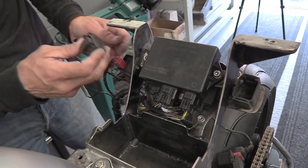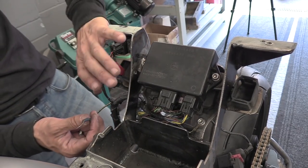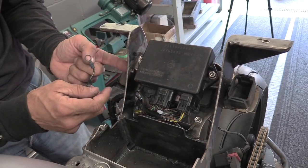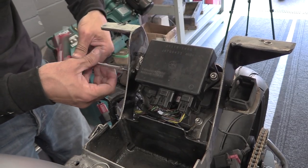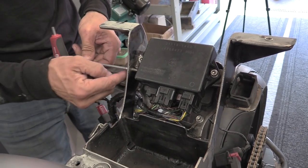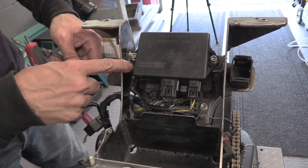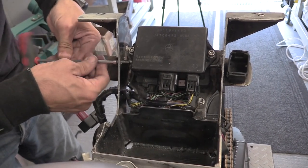A couple of little relays there - I've got one that goes in there, that one goes in there - so I've designed them to be nice and out of the way. There's another one of these little earth leads just there, so that's got a little hole drilled and tapped exactly like the one just now, and it will be a little M6 Allen screw in there to hold that earth in place. Now as you can see if I just did that up now, that bolt is way too long - the end is touching the ECU, which stops it from moving and is rubbing on it. At the very least that could cause impact damage on the plastic body of the ECU, and if you crack this you trash the ECU.